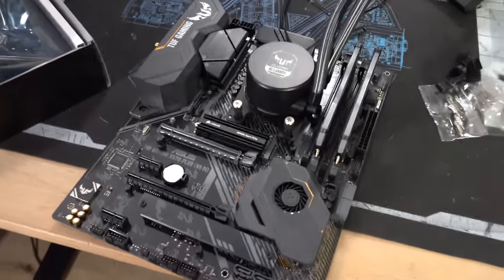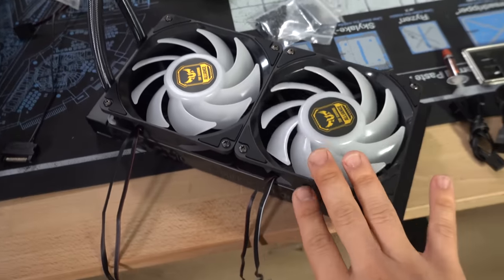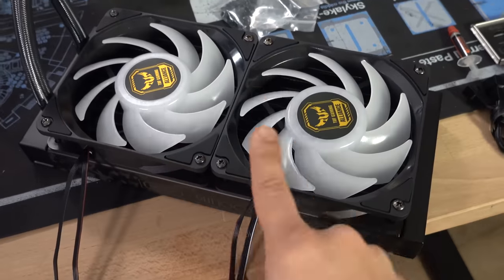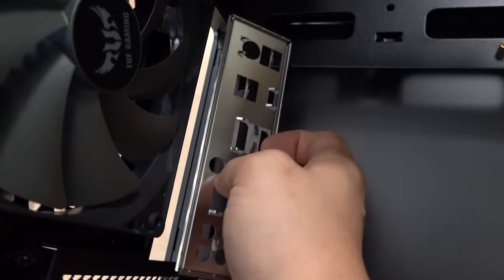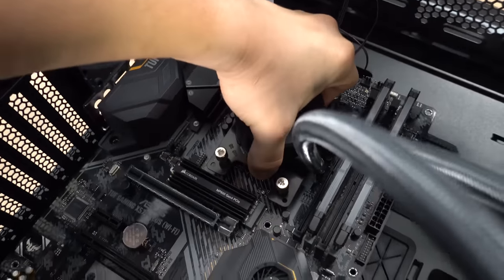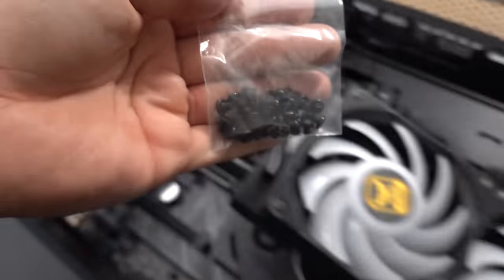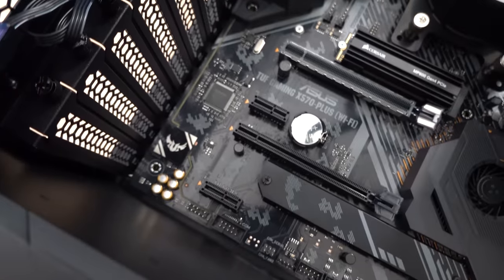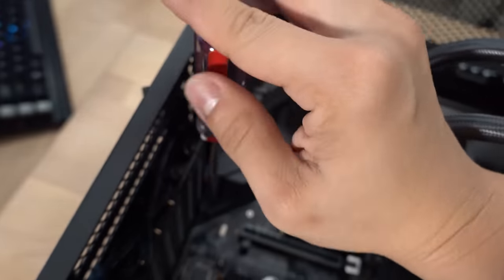The motherboard is fully prepped and ready for case installation. Okay, I lied. I actually had to put the fans on the radiator first, and I already did that. Ah, the IO shield. So easy to forget, but so essential. Otherwise, you have a really nasty looking back end. Easy does it. Press the radiator here for a moment while we get some screws. Do we want fine thread or coarse? I'm not sure. And it's coarse. Of course it's coarse. Now let me just do that 8 more times.